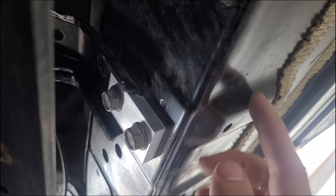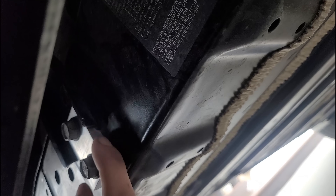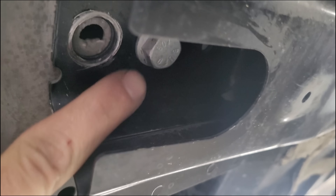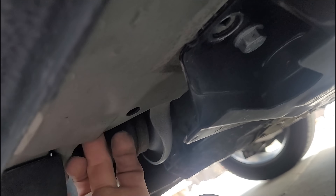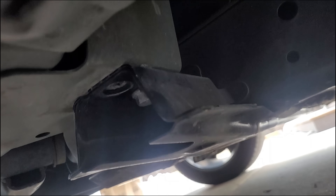Here are the brackets at the rear of the battery that I made. The original bracket is on the car — the battery is 40 millimeters lower so I'm using the lower hole. I created this aluminum bracket that's stepped right by the tip of my finger so it nests in with the current bracket, then just two bolts reusing the same hardware on either side. On the rear-most mount there are now two bolts instead of one, but the rear trailing arm mount is right behind it and I don't know how you'd ever get a wrench on it to tighten it, so I'm leaving it — there are more than 10 bolts supporting this and it's definitely good enough.